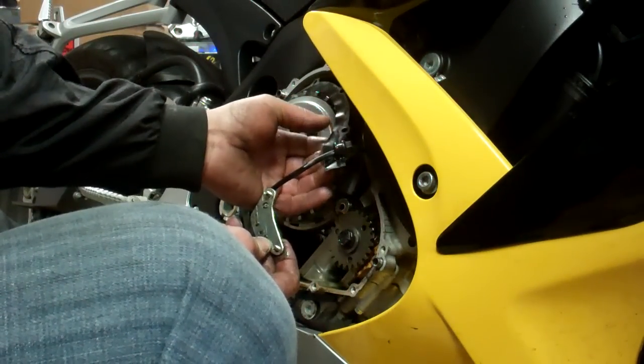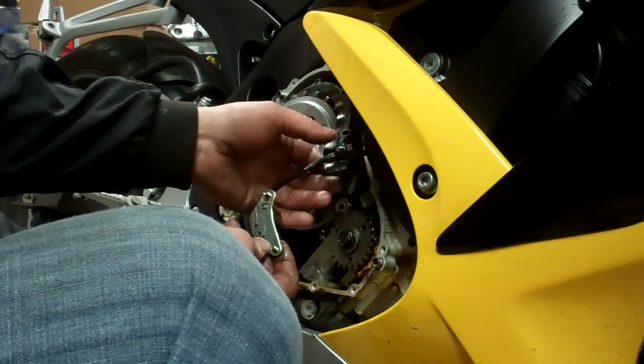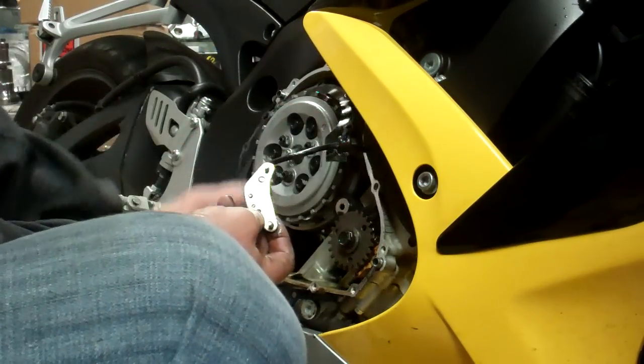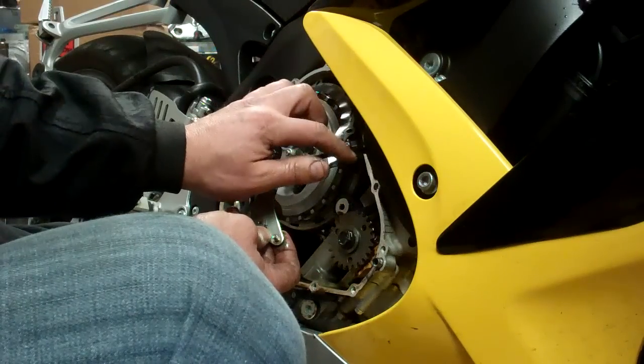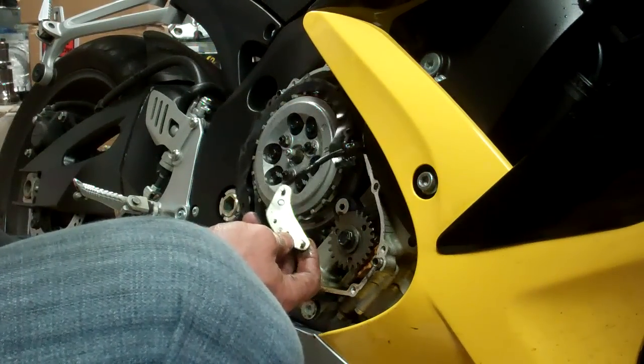The little tiny rubber grommet up here sits across the gasket on the top side and goes into the cover on the other. I'm going to clean it off real good with carb choke cleaner, avoiding getting any of the runoff on the panels to protect the paint. Then put just a tiny bit of silicone on there to make sure that it doesn't leak, and then we're going to bolt the cover back up.